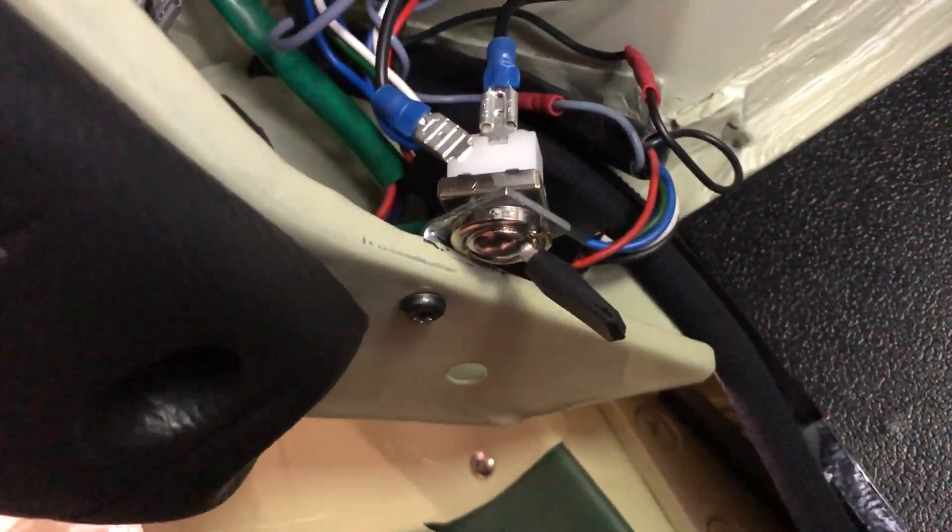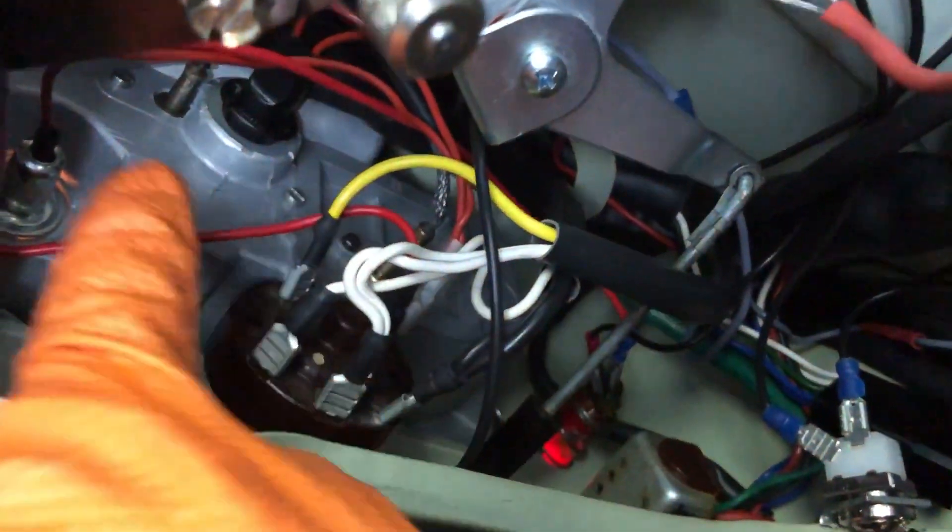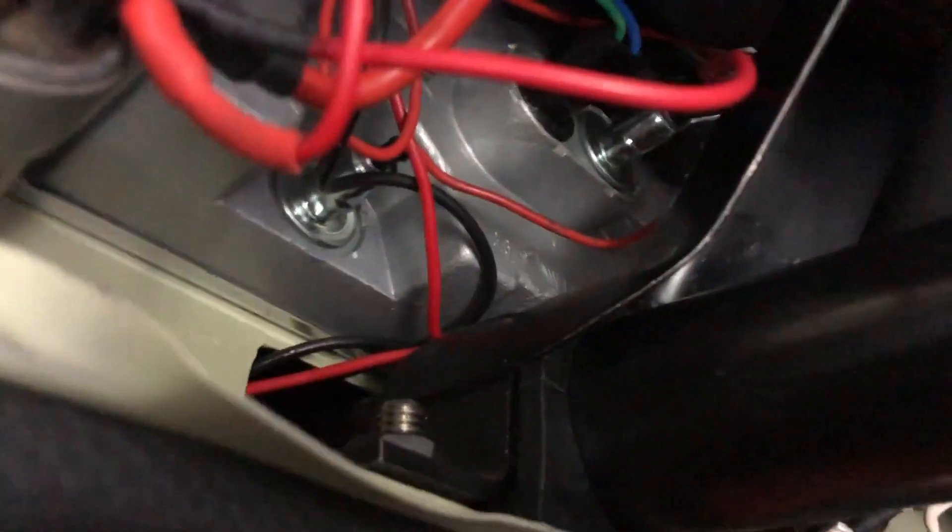Here's the back side of the switch and there's the bracket. You can see the screw that holds it in place; the bracket is affixed by the lip in the dashboard. There's already a half-inch hole right about here, but unfortunately it's between the screw holes on this lower dash pad. If the lower knee pad wasn't in place, I'd just mount the switch into that hole — that's the way I did it in Bruce. While you're here, do check that light bulb and the other side. Make sure you've got 2-watt bulbs, not 4-watt, because 4 watts will melt the green lenses in your gauge cluster.